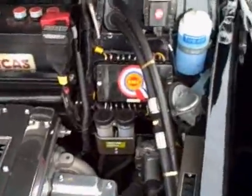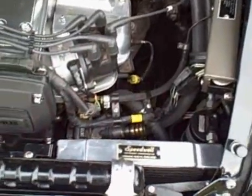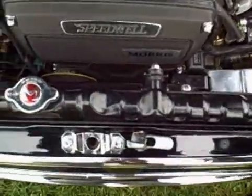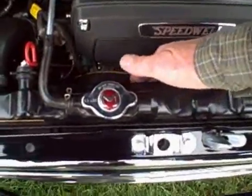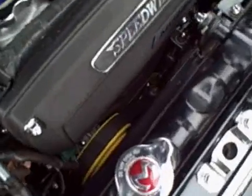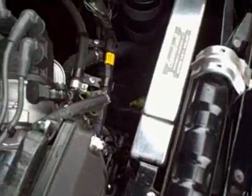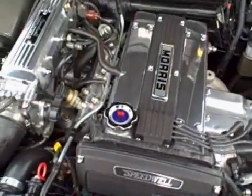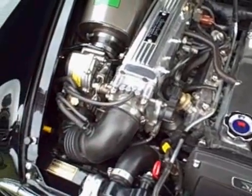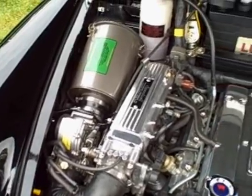What were some of the other challenges — all this beautiful workmanship, and you fitted air conditioning as well? Air conditioning is super challenging because there's barely room for the radiator, let alone air conditioning. You can see how tightly the AC condenser is packaged — it's actually partially covered by the radiator; the condenser is behind the radiator. A friend who's an engineer at Vintage Air told me it wouldn't work, but I told him it would work just fine with enough airflow, and in fact it does. The car cools great. Packaging the air conditioning was a huge decision in terms of timing because absolutely everything had to be fabricated, and the under-dash packaging was very, very difficult too.